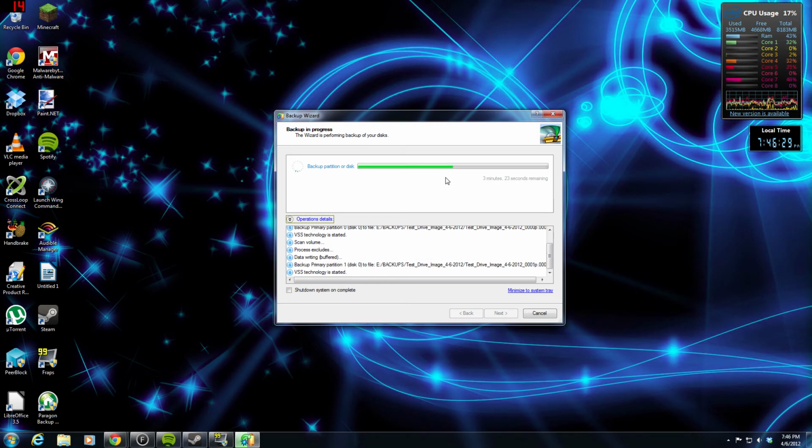It should be secondary to things like restore points, or rolling back, or using the repair install methods on the Windows DVD. But if worst comes to worst, I found out personally that having a drive image is going to be really awesome, and it's going to save a hell of a lot of time getting back up and running, especially when it comes to things like program activations.